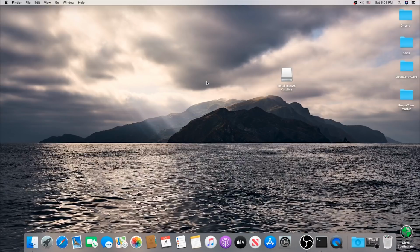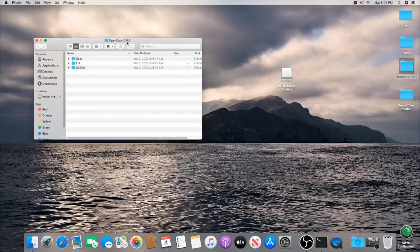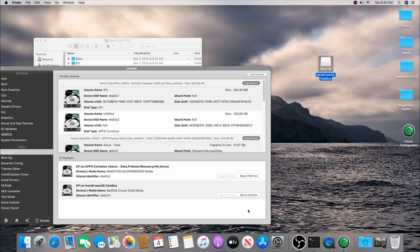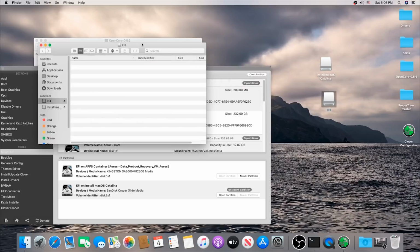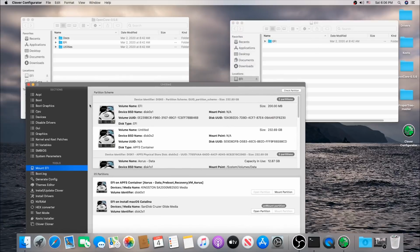Now, in the description below, you'll be sent to my website to download these files. Okay, so you'll have all of these files, and right now we need Opencore, and this is version 0.5.6. And right here we've got Clover Configurator, and we're just using Clover to mount our EFI partitions. EFI partitions are hidden, so right now we need to mount the one that is on the USB. So right here, here's my USB, we're going to mount it, put it on, and then right here we'll have the EFI partition, and there's nothing inside of here, right? So what we need is this Opencore EFI folder. This EFI folder needs to go into our EFI partition on our USB stick. I'll close this out.